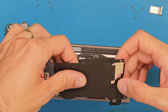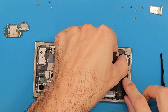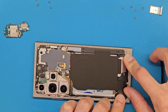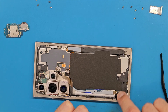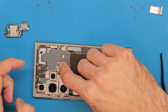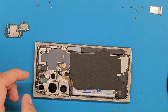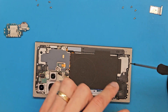Get the buzzer back in place. Align it properly and apply pressure on the two sides — it should click in place. Don't forget to connect this wireless and NFC flex cable. And let's get the screws back in place.